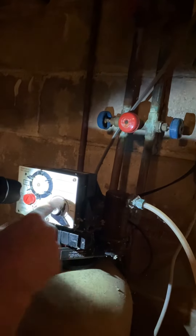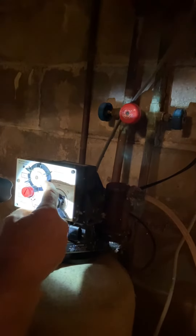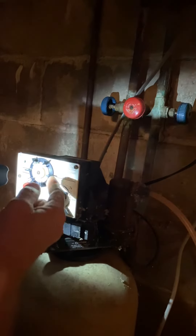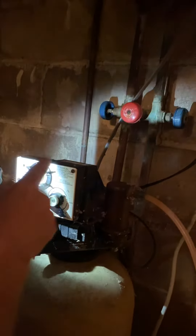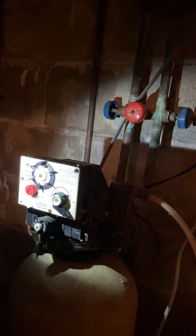So you come down here at six o'clock tonight and that little pointer should be at six o'clock. At 2 a.m., this arm is going to be over here and it's going to push this. If one of these tabs is pushed in, it's going to kick it into a cycle. If not, it'll just catch the next day and flip around until it hits one that's pushed in.